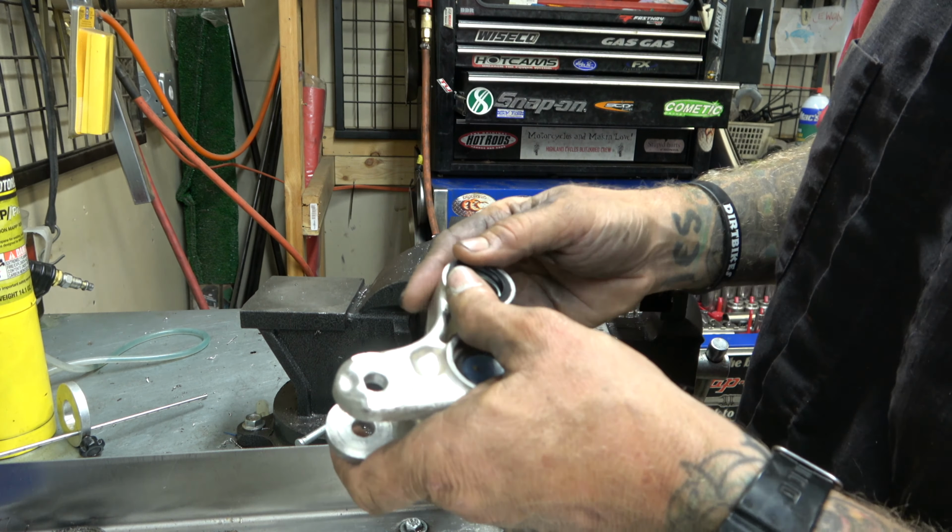All right, now the dog bone. This one, honestly, is a lot more of a pain in the butt. Mainly because inside here, it necks down to hold the bearings, which is good. That means you can't overpress the bearings in. But it also means you can't just push them through, so you gotta drive them out. And they don't always want to come out.